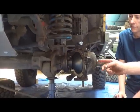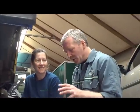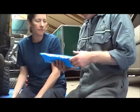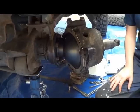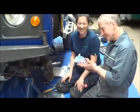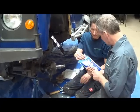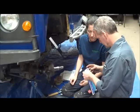But now that's kind of redundant because you use grease. It's one of the most highly contested things in the Land Rover world as to whether you use grease or oil. But with a constant velocity joint, you use grease. You get a sachet of swivel housing grease, and it's sometimes referred to as one shot grease. That's because in the bag, this is one shot, and it all goes in. So you can undo that. And there's a nozzle here. Give you a nice little nozzle.